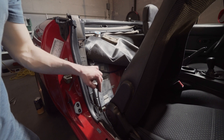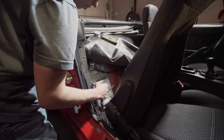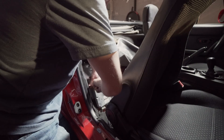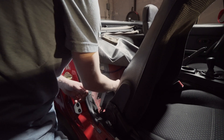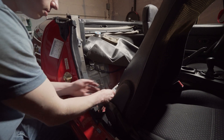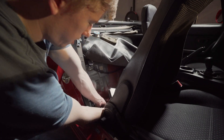Got our map line through. Now we've got to take the old ECU out — it's three 10-millimeter bolts: one here, one here, and one right here. Looks like there's a ground there, and then you're supposed to be able to push the harness back this way. I stopped recording when I got it out — basically I set the ECU to the side and came in with a flat head.